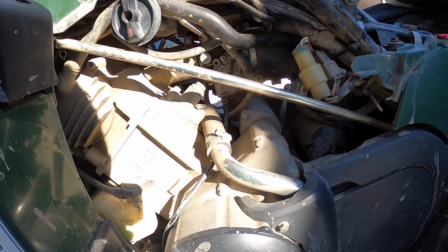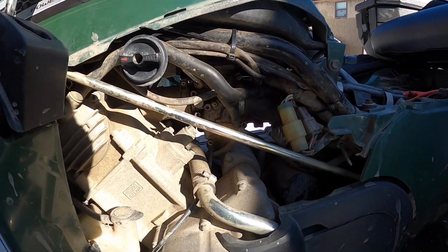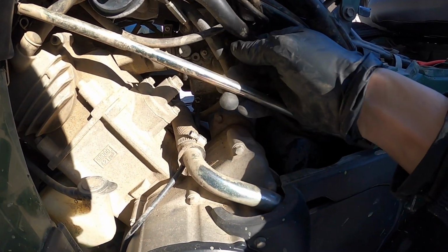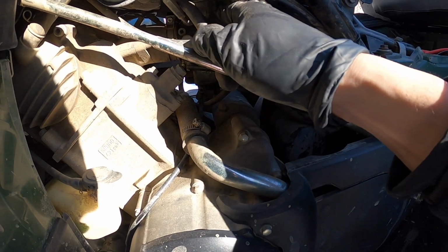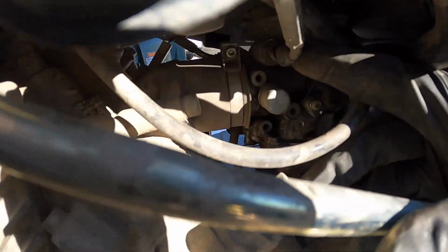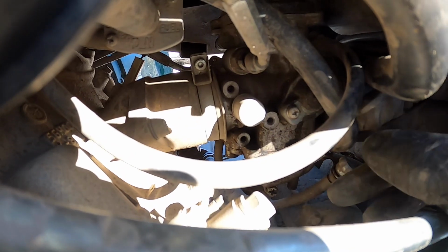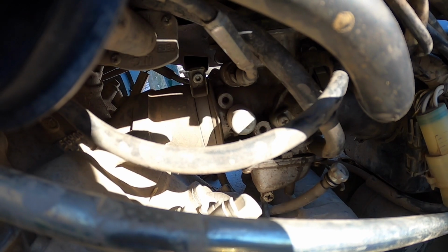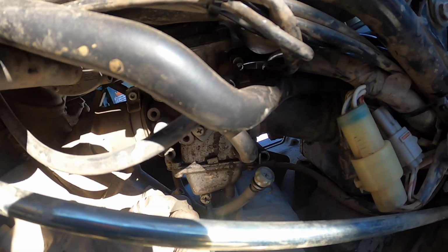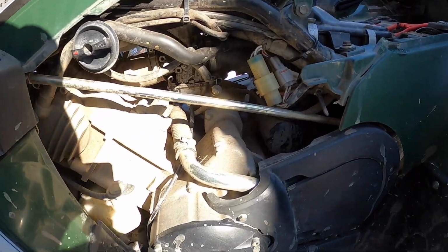All right, so the carburetor in this guy. Not a fun time to get out, not gonna lie, I've done it before. Fuel goes off, goes in the horizontal position. It's most quads, I think. Then we're gonna take the fuel line off. Usually I have a bolt the size of whatever the fuel line is, so I can stop the fuel from flowing. And then we're gonna take out the choke cable, which is, sorry, I cannot get in there with the camera, but it's this guy right here. That's the choke cable. Like I said, here's the fuel line. And then on the other side, we had to take out 3 screws. We got the throttle cable we got to pull out. And then I think last time I might have popped out the air box. Not sure. Hopefully not. I think it was a heck of a time. So hopefully we don't have to do that.